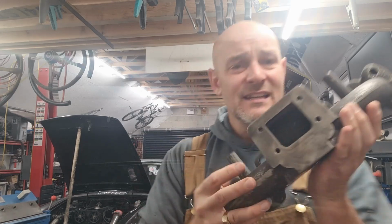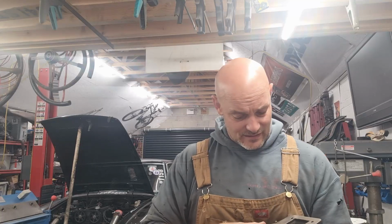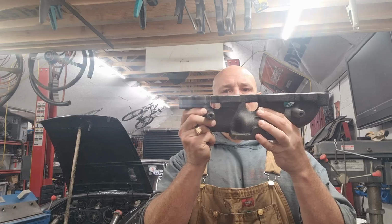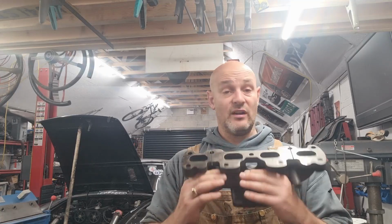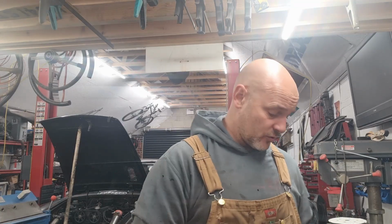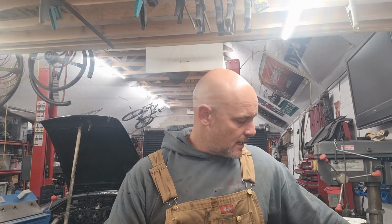Apart from that, the casting, I don't know whether you can kind of see in there, the casting is pretty good. It's certainly better than I expected. I've checked the level of the face and it's pretty much nigh on. I'm trying to find a straight line, but I can't see it being that bad. It looks alright from doing an eye with a straight line with a ruler. So hopefully we should be alright. Obviously there's going to be some work to do. Mainly, I think the exhaust downpipe will need to be changed, needs to be shortened, I think.